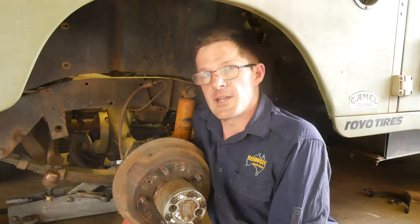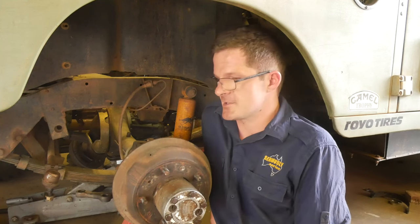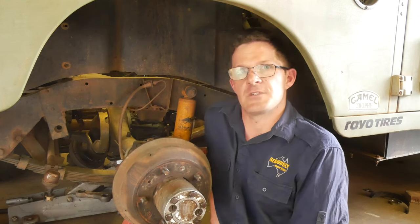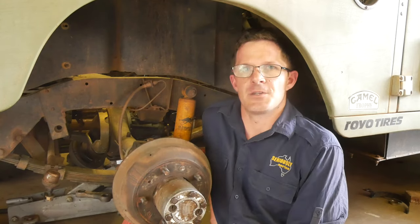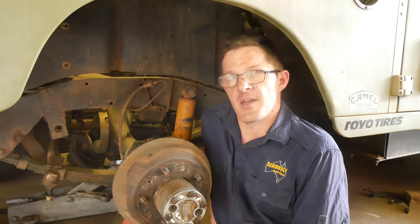There is one thing you must be careful of: there is actually a seal in the axle housing itself. Pulling this out can be a little cumbersome, so you have to be careful not to score that seal — it's probably the only downside of the entire process. Particularly with more modern variations like the Defender 110 and everything that follows, the swivel hubs have CVs rather than universal joints, so they carry a molybdenum grease. If you score the seal, the molybdenum grease will inadvertently appear in your diff oil, turning it a very silvery black colour, which is not a good thing.